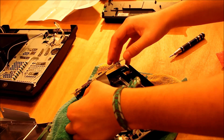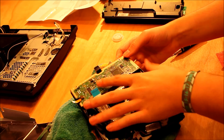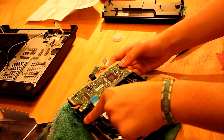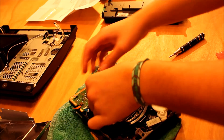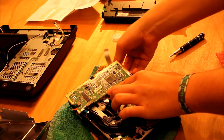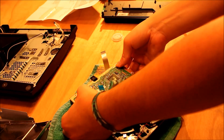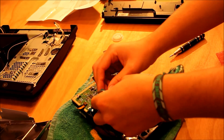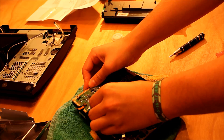Keep this piece out. Now we have to get this in here — line it up. There's a blue tab, two blue tabs and a brown tab; make sure they're not caught in anything. To get this in, you have to slot the board underneath the two little clips, and then push it down, and then it should snap into position. You have to get all these tabs in — find the best way to do that is lightly push it, and then apply pressure to each side until it slides in.